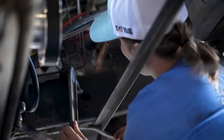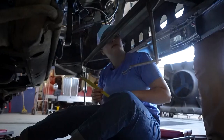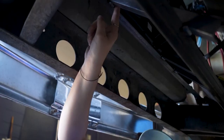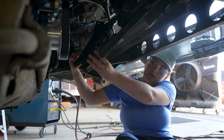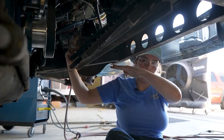Hi, my name is Lorelai. I'm going into my senior year here at Bonneville, and today I was with Mr. Art. We were working on the transmission and oil coolers, mounting them. We took two angle iron pieces and mounted them across the frame from here and here, then got four smaller pieces and mounted them here and here, so we could lay the coolers on top. We picked the specific angle because as you're driving, the air goes this way and will naturally cool them off.